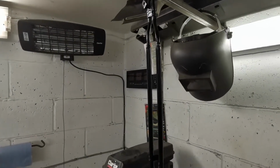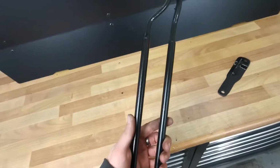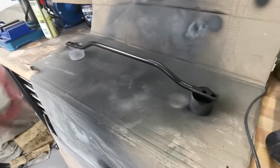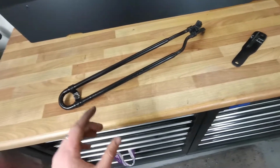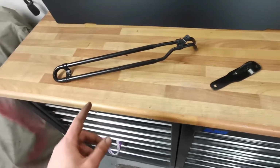Finished painting the other bits and pieces yesterday, including this PAS cooler, which was disgustingly corroded. It's not come up too badly, to be fair. I've actually used stone chip for the paintwork and got over it with a bit of lacquer just to tidy it up. Really thick, so with any luck it'll offer some decent protection and stop it going mad rusty again.